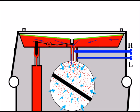So this drawing in of fuel occurs when the piston's on the upstroke, because when the piston's on the upstroke on a two-stroke engine, it draws in the fuel-air mixture behind it. I won't go into that too much here because I do have another video already on how a carburetor and an engine work together on a two-stroke. So please do take a look at that if you need to. But for this video, I just wanted to explain what happens there briefly.